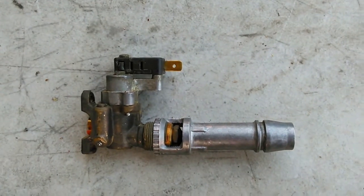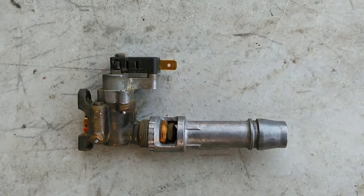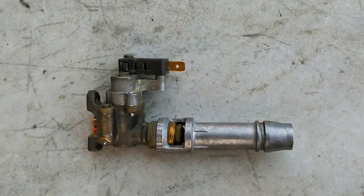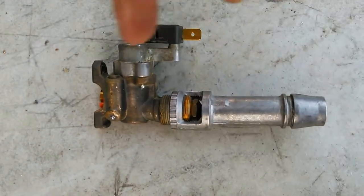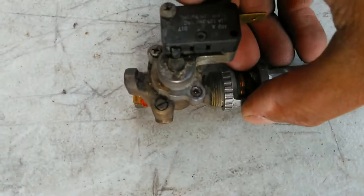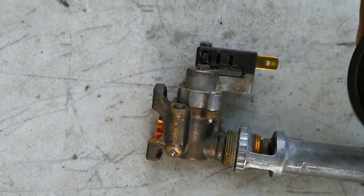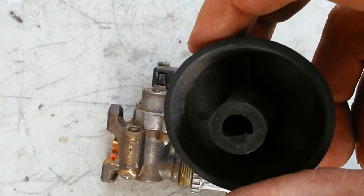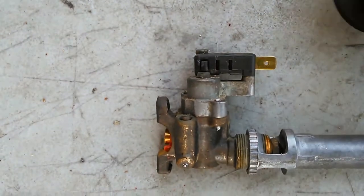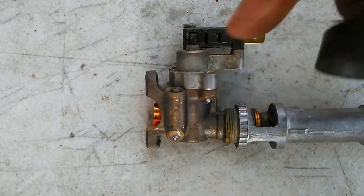Today I'm working out a piece for a Viking stove that got broke — doing this for a friend. What happened was this valve here, the gas goes through here, this valve stem which is right here at the top got broke. Normally the valve stem is half round when it gets to the point where it goes in the knob, and then this part is round, so it was machined to have a flat end and then the round part that goes through this.